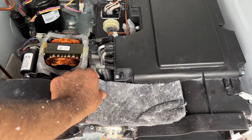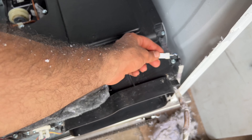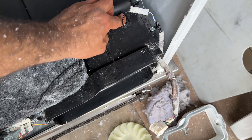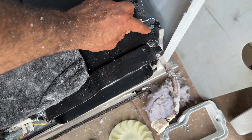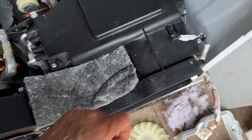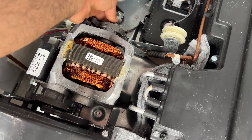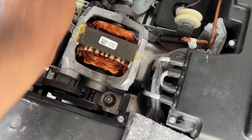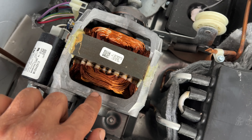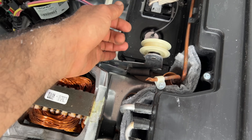This little small insulation — do not forget to add this. When I added my screws I kind of forgot to add this bracket and the small clip that holds the thermistor in place, so I had to pull the screw out and re-add it. Before you put everything back together, check your motor — just spin it to make sure it's good. The air compressor made the motor look brand new. Double check your idler pulley because you don't want a callback — if the pulley is not good you might need to replace it, and that's a $20-25 part.